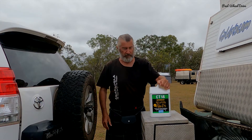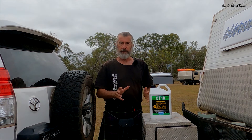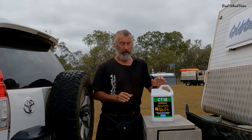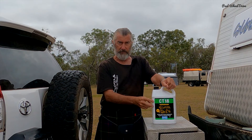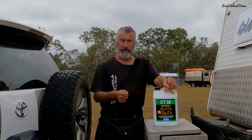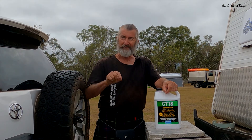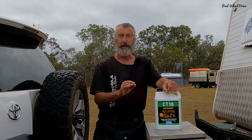I feel compelled to tell you about this great little product — not a sponsor by the way — CT18. It's kind of a washer degreaser all at the same time and it's quite powerful. I use it on the caravan, have been for a while now, and it just brings the caravan up beautifully. I'd now start thinking about using it on the car. The trick is to use it well diluted, put it on whatever component you're going to do, give it a bit of a wipe, a bit of a scrub, and then rinse it off. I'd do all that in about 10 minutes — I wouldn't be leaving it on. If anybody's used this before and left it on for ages, please leave a comment down below. Love this product — it gets the car or the van really nice and shiny.